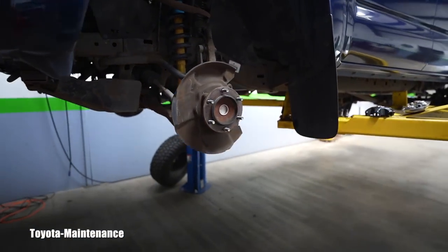I gave him a price, noting that it assumes I can resurface the rotors on the brake lathe. That's always what I try to do for owners — I don't see the point of replacing beefy OEM Toyota rotors with aftermarket parts when we don't know the quality, material, or grade of metal used in production. My rule is to save money and keep quality OEM parts on the vehicle.